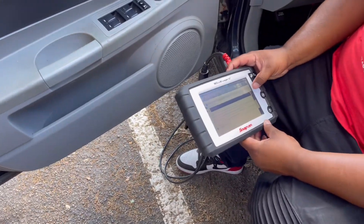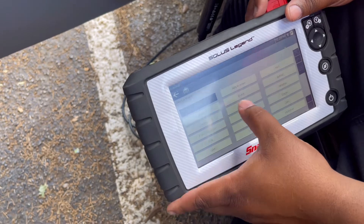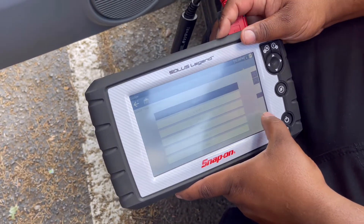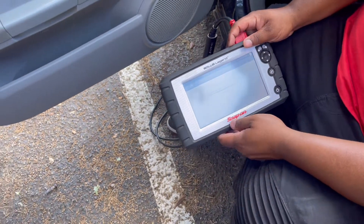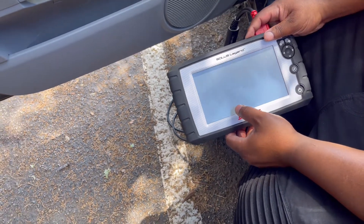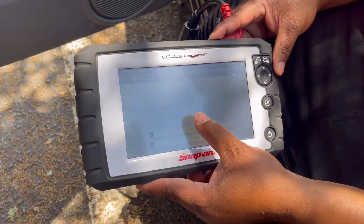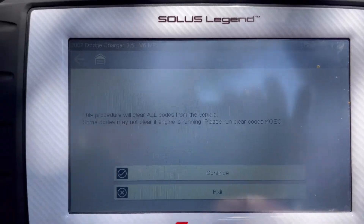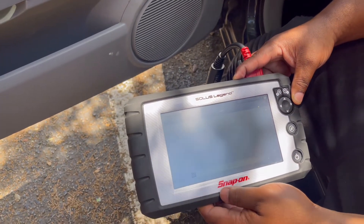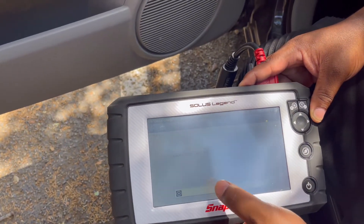So what I'm going to do now is go back to my scanner, back to the Dodge — the 2007. It's automatic, we're all back up again. Clear all codes — read by the scanner, get that option to clear them off. It tells you before you do it — it will clear all codes from the vehicle. Once you do that it's going to clear them out. It's in progress, clearing transmission codes now — engine, brake codes — and that's your car letting you know that it's doing it.